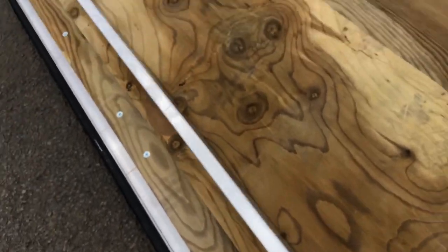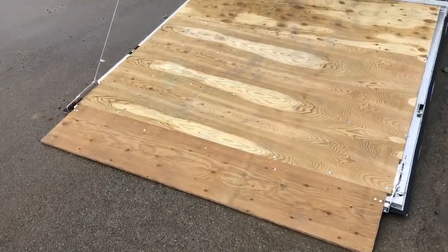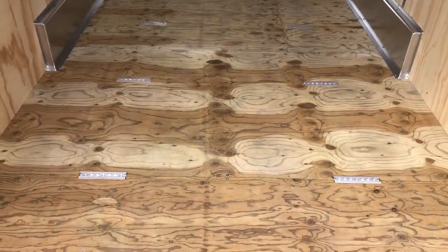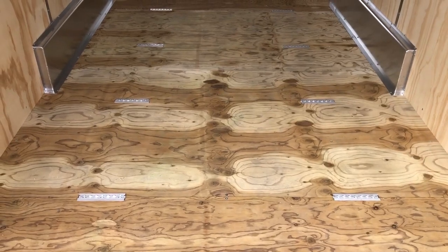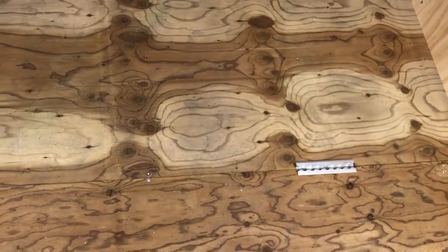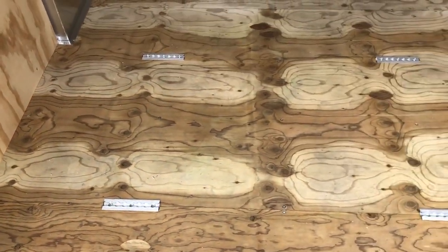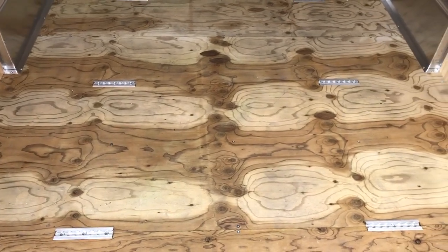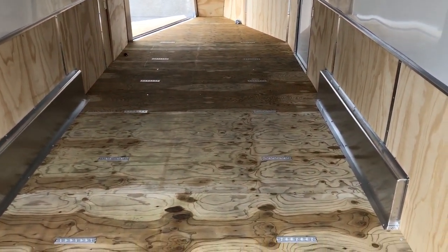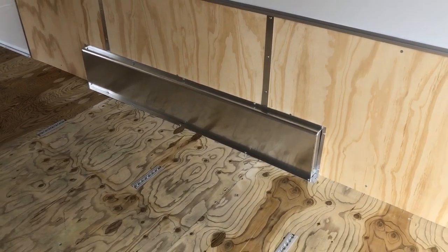Same pro flap at the rear — it's got outside hinging so if you're taking sleds across it, it won't mess with your carbides. Inside, one thing we've added is the floor tie-down system, or the sport tie-down system as they call it. Basically there are strips of aluminum airline track on each of the cross members. Three lugs in each one. Airline track fittings are generally rated for a few hundred pounds — ideal typically for bikes, four wheelers, golf carts, potentially a UTV, etc. It gives you a lot of convenient tie-down points and the airline track stays pretty well flush with the floor so it doesn't protrude into the usable space.